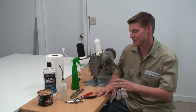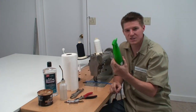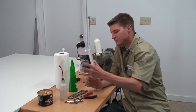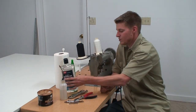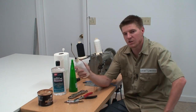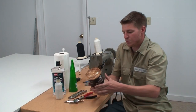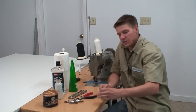Whenever you're cleaning your sewing machine, these are the supplies you're going to need. You're going to want some paper towels and some cleaner — this is just Simple Green that I put in a regular squirt bottle. It works real well for cleaning everything: my tables, my machines, my tools. You're also going to want some glue remover for cleaning off any glue or overspray that got onto your machine or tables. We're going to need some sewing machine oil for lubricating all the parts, and you want to check your manual to make sure you purchase the right type of oil your manufacturer suggests. We're also going to need some multi-purpose grease to grease some of the gears inside the sewing machine.